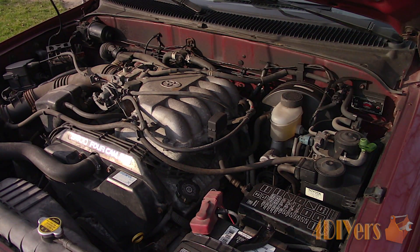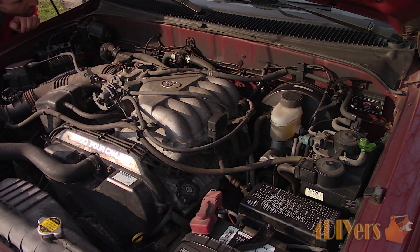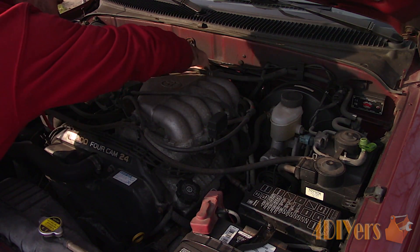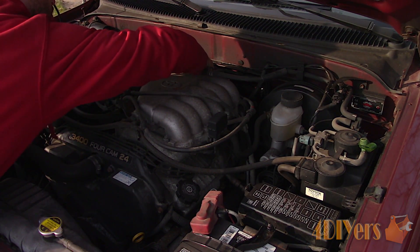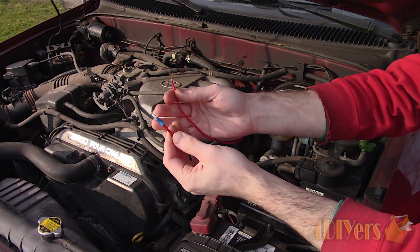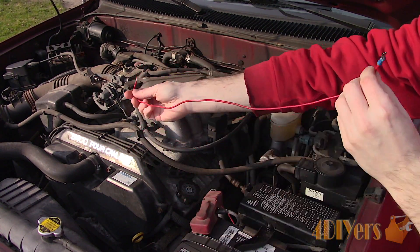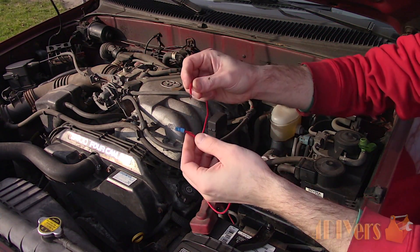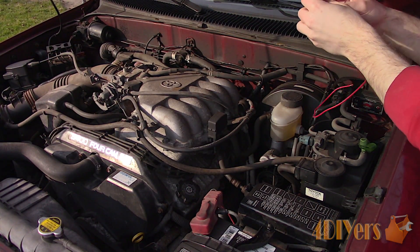Starting with the basics: on this model of engine, the sensor for the gauge is located at the rear of the engine bay behind the air plenum. It can be hard to see as it's in an awkward spot. You can isolate the issue at the start to determine if it's a sensor or a wiring and gauge cluster issue. Disconnecting the sensor, just pull off the connection. I have made a jumper wire as you can see here. Make sure it's long enough to connect to a sufficient ground source. One side has the insulator stripped back and the other side has a spade connector.